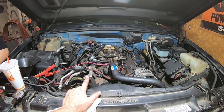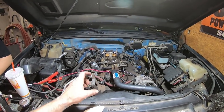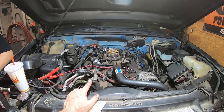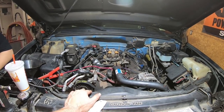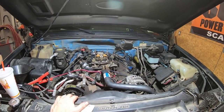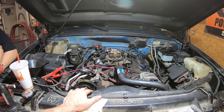We did find something online that says that there is a plunger about 4 inches long with a spring on it that goes, once you drop the tranny pan and tranny filter, it goes up inside there and it's for the torque converter. They say that that can cause this issue too. But other than the distributor and that, those are the only two things we have not done yet. So this is where we're at. The story of the saga of the Duelly continues.